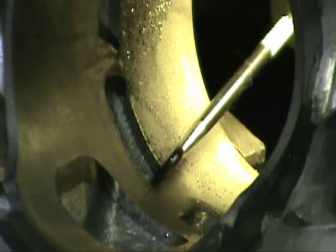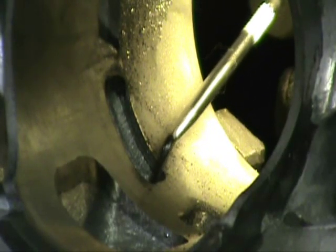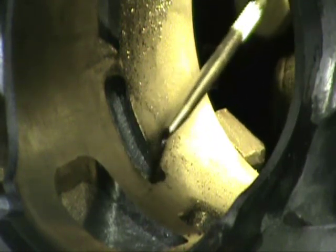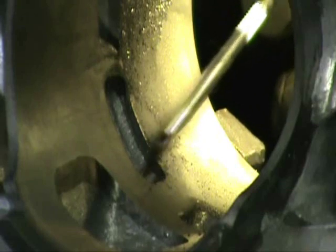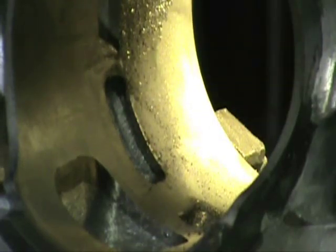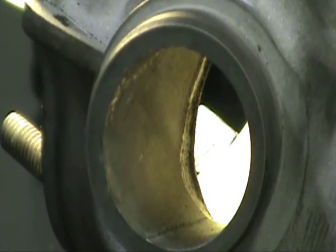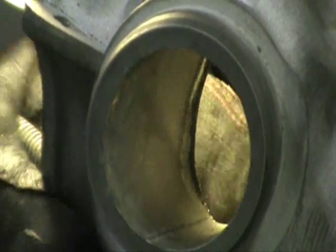We work this with the 90-degree tool. As you can see it's much smoother — it's a little thing, but lots of little things add up to some big stuff. Pretty much done with the transfer ports and matching the lead angle into the cylinder.